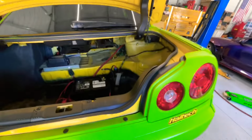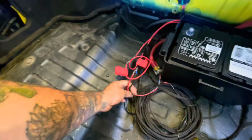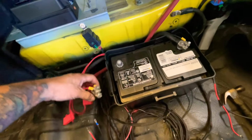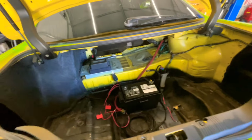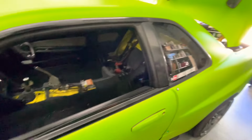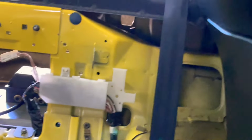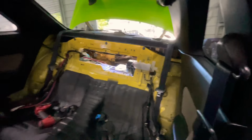Let's get it. All right, I'm jumping around everywhere, but I got the electrical connectors done for the compressors right here. And then I wired up the manifold and the other compressors to the connectors here, the terminals for the battery. Next, I'm going to do the other front bag because I want to get this front done first, and then for the back I'm gonna have to remove that piece on top where the speakers are and remove those seatbelt retractors, so we can take out the struts. Let's get it.